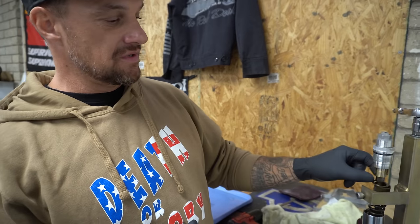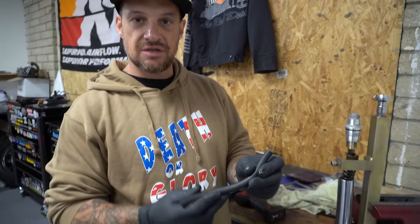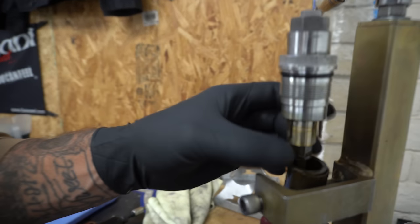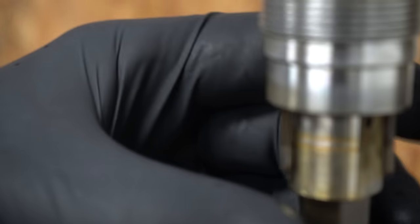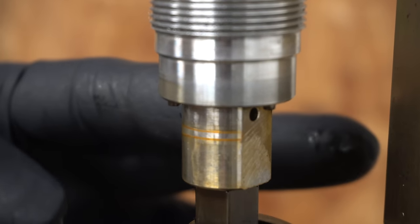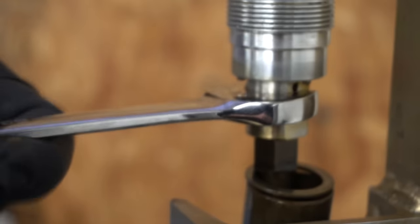You're also gonna need a piece of hose. They make a specialty tool for this to screw onto this and hold it down, but I just use a piece of like quarter inch hose, fuel line. Works out pretty good. When you screw down the preload, it pushes these pins down on this washer, and that's what creates more preload. That's why you want to back this all the way off so you can get these guys out of the way. 17 millimeter goes right here.